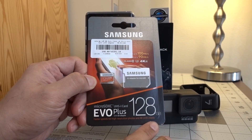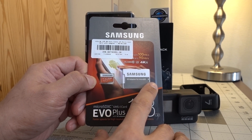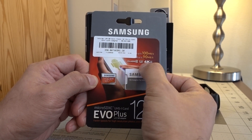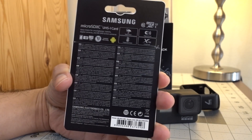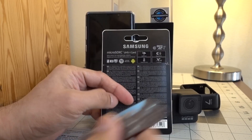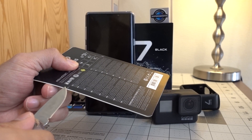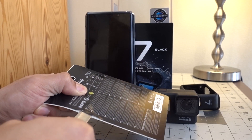For choosing a micro SD card, I recommend visiting the GoPro website to check the list of recommended cards. No memory card is included in the package, so it is recommended to buy a micro SD, micro SDHC, or micro SDXC with a Class 10 or UHS-1 rating. It can hold a capacity up to 256 GB. Make sure your hands are clean and dry before handling the SD card.